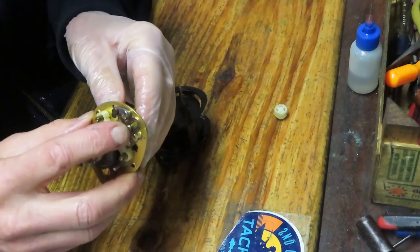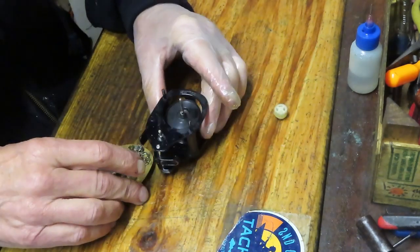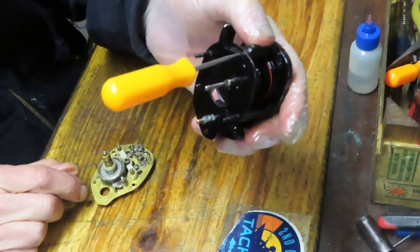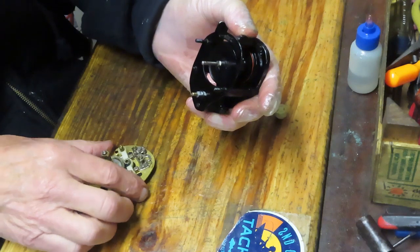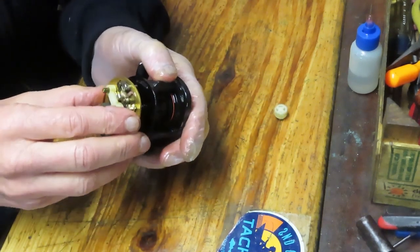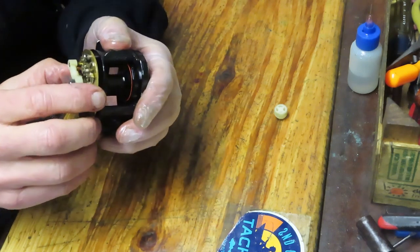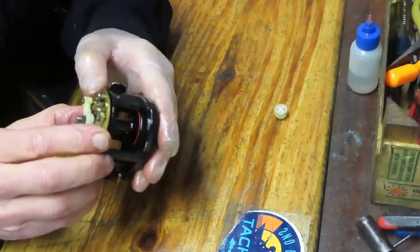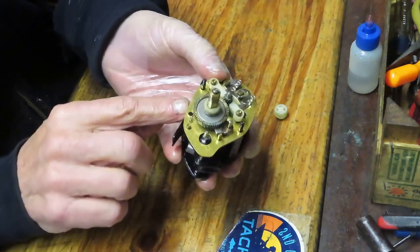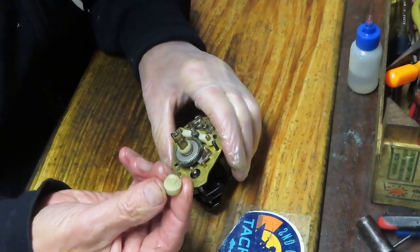We have this trip assembly here. There's a kind of nail spike sitting out, and the arm has a hole in it, so when you go to install you need to put that peg into that hole while doing everything else. Line the case up with the points up, then make sure it seats nice and flush all the way around the case.